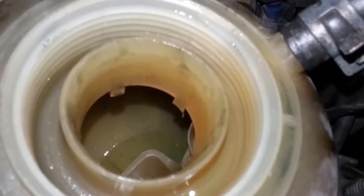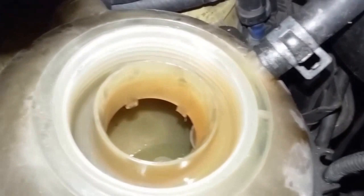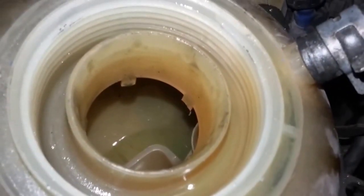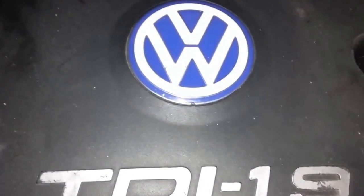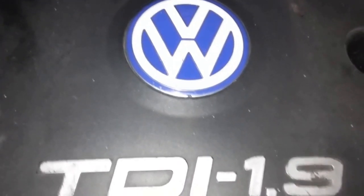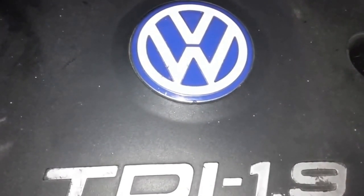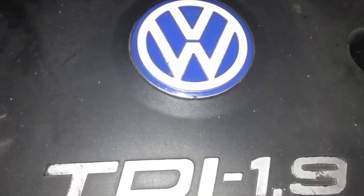When you fill the reservoirs up, don't just assume it's full. Run it until it gets to operating temperature, then let it cool off and check it again. I've had some luck putting the pressure tester on it before I crank the engine up, then playing around with the hoses — squeezing them and whatnot — then taking the pressure tester off and topping it off. If you have the luxury or permission, take it on a long test drive like taking it to lunch, letting it cool off for a couple of hours, then checking it again — or driving it home, letting it cool off, and checking it again before you leave in the morning. Check it two or three times. Just don't do that without the customer's permission.